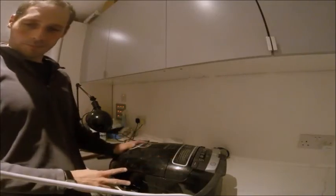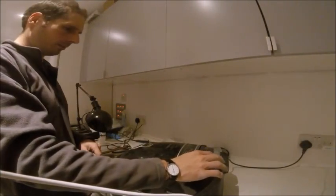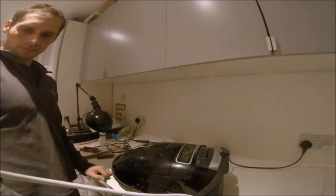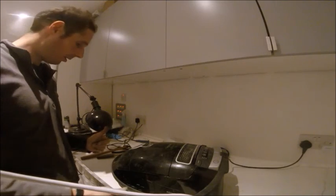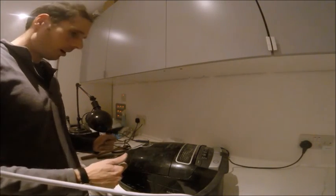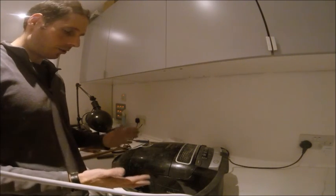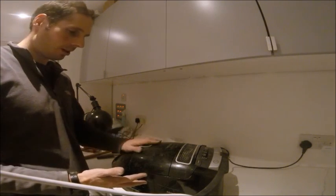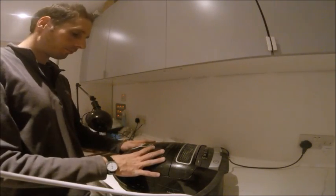The hoover's all back together. All that's left is to test that it works — plug it in, turn it on. Thumbs up! We fixed the hoover. It cost me eight pounds — I bought two triacs and had to pay postage. The triac itself was about one pound twenty, so if you can get it cheaper you can do it for a couple of quid.